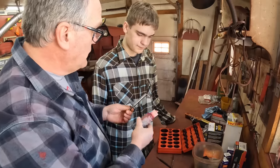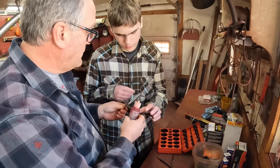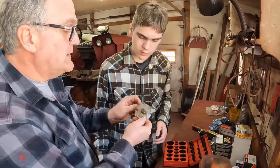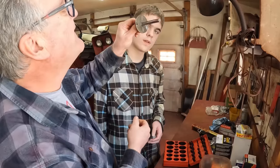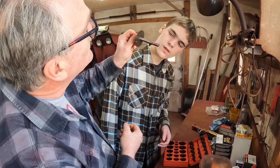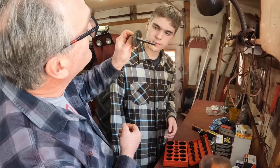And next you can use the Ultra Slick — put a little bit on here and smear it around to prelube that. Then as a final check you just want to eyeball it and spin it and make sure it isn't bent, because sometimes these are bent and I don't remember checking that when I took it apart. Looks good.